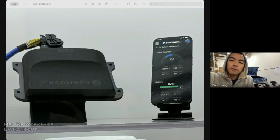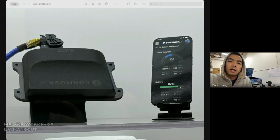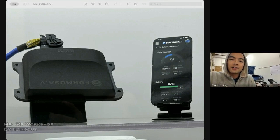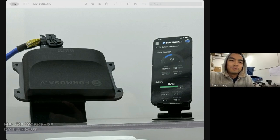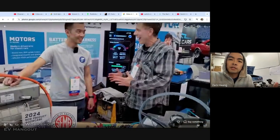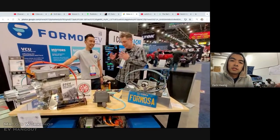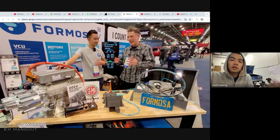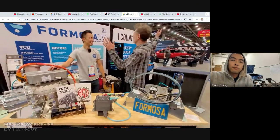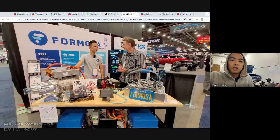And I think that's partly why the Hyper 9 has been so popular, because you don't really need a VCU to control it. It has those features built in. You plug in your accelerator pedal, you plug in your gear selector, F&R switch, and it works nicely. We put one in the Summer Bus with Mr. G last summer. It's relatively plug and play, and no disrespect to the folks that helped bring this community up with that setup, but it is older technology, and I think the next step is really to enable DIY users to use 400-volt modern powertrain systems, using new motors from China, from Taiwan, from America.